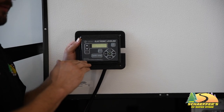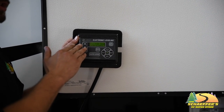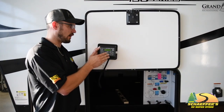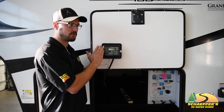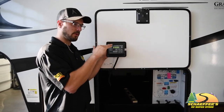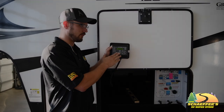The other reason you get feature disabled is if after you've auto leveled, you manually adjusted it — to get the rainwater to run off a different direction or for whatever reason — or if the jack sunk a little bit and you've re-leveled the trailer, that auto hitch height feature will be disabled for those two reasons: you didn't start above level, or you've adjusted the levels from when you hit auto level.